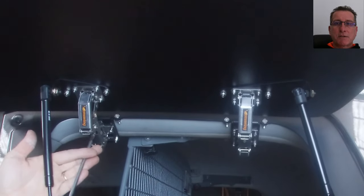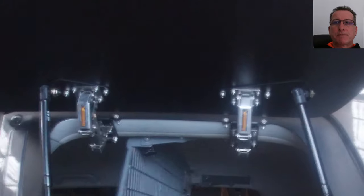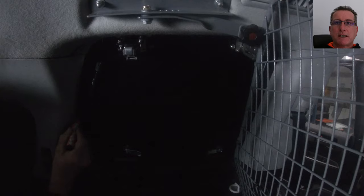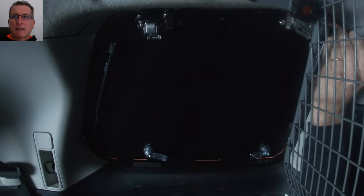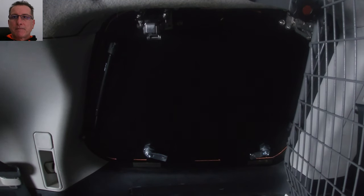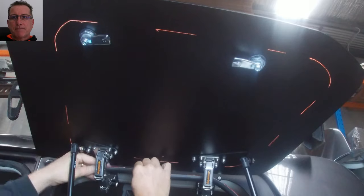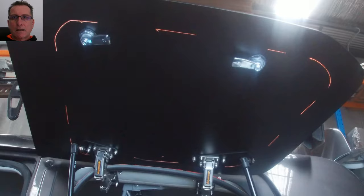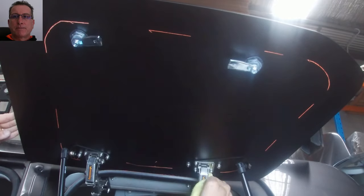Now I'm just going to tighten up these two height adjustment screws on the hinges — just as a matter of course. This just limits the height the hinge can actually be opened to. Now with the chalk pen I'm just going to mark where the door panel sits in relation to the frame. You can now see the marks I've made around the door panel — this allows me to place the rubber shortly. Now I'm going to feed the rubber through the hinges, keeping it well away from dust on the floor. Then I have a bit of a clean up where I want to place the actual rubber, being careful not to remove my chalk lines — just a bit of wax and grease remover to clean off any grubby prints, ensuring a good adhesion.